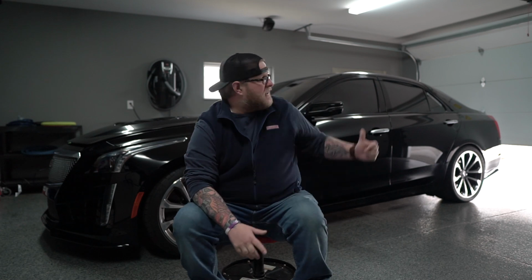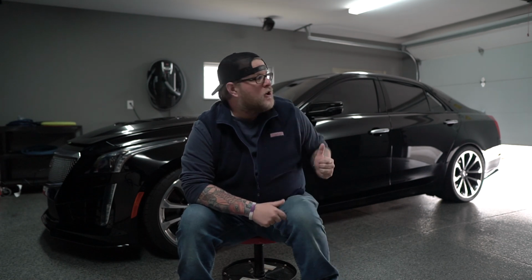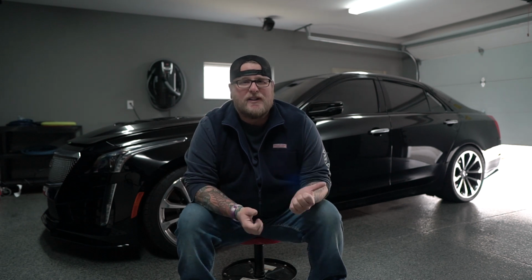This car actually has had a 3-stage paint correction. I did not do it myself because of the micro marring, and I just didn't want to spend the time. So I had somebody come do it for me. I said in another video that he thought he could do a 2-stage. The car was so bad it needed a 3-stage, but we still were dealing with micro marring. The car probably doesn't look perfect right now. That is because we're getting ready for the wrap, so the ceramic coat actually had to be taken off in order for the vinyl to stick to the car, and now there's micro marring.